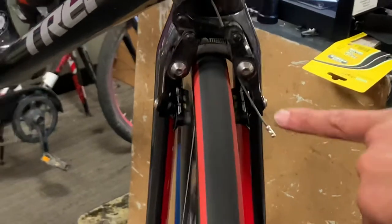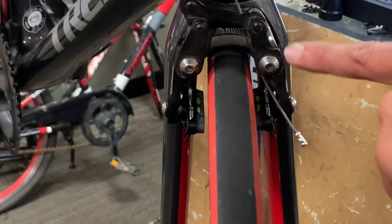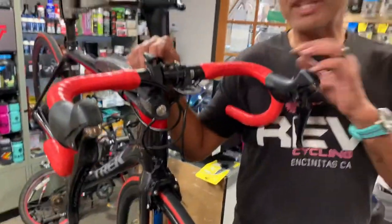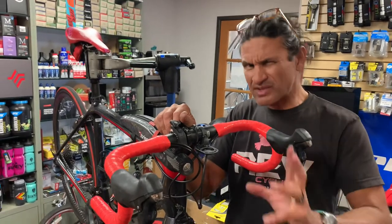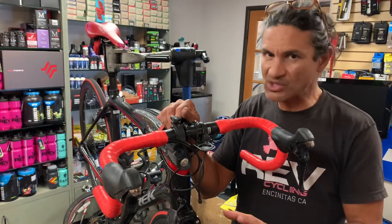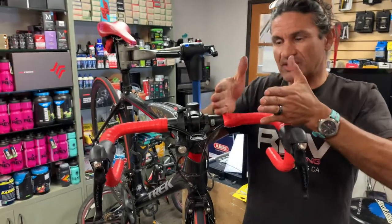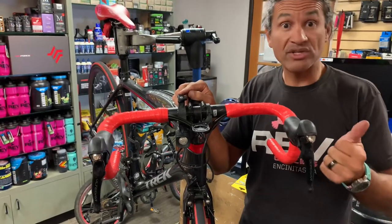You can see the brake pad is touching in the front but the back isn't, and that'll keep your brake pads from squealing when you apply them. You do the same type of process on an aluminum rim, but honestly they hardly ever squeal or make noise. On a carbon wheel it's very important to get that brake pad toed in — front of the pad touches first, then the rest collapses around it. And again, it's very important to use the correct compound.